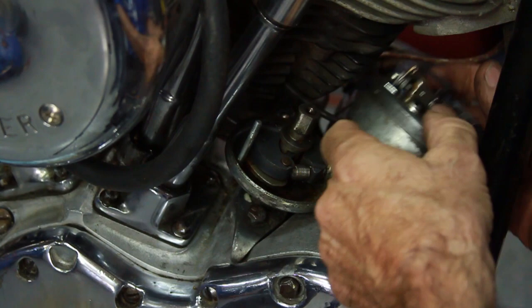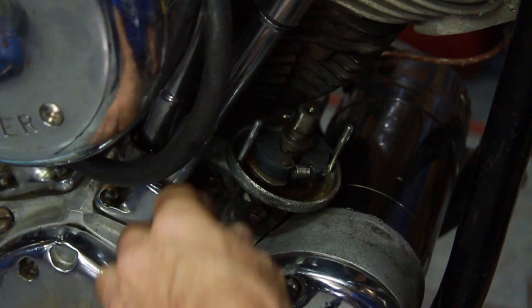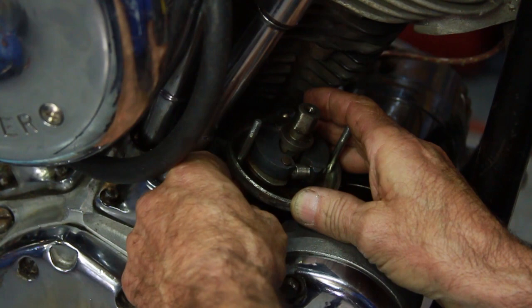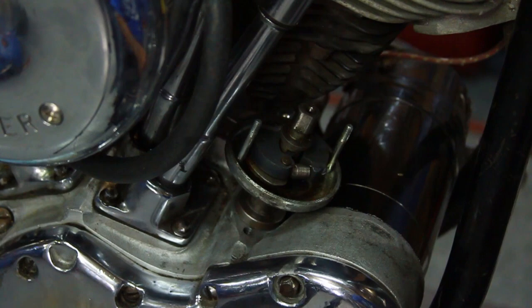In fact, you can just disconnect your wire and pull it right out of the way. Next, you need to remove the bolt or nut, whatever you have, on the horseshoe clamp. And you want to be careful here because any debris down there — you don't want it to fall into the hole that'll be left when the distributor comes out. So at this point, wipe all around here. And now we're ready to just pull the distributor on up.